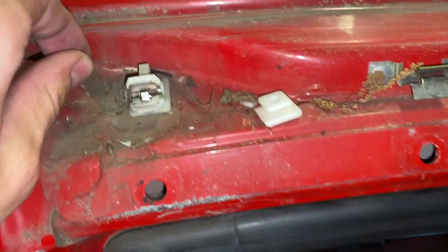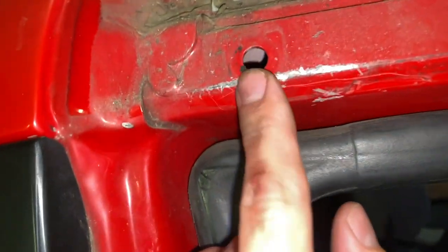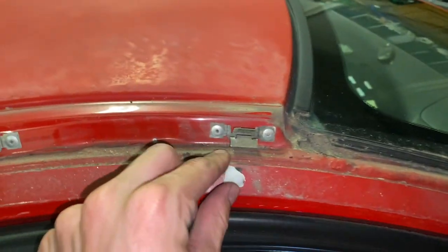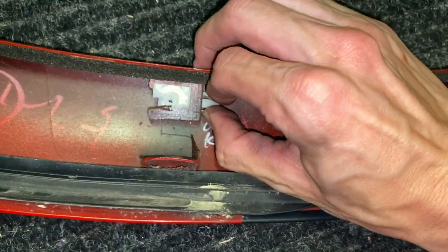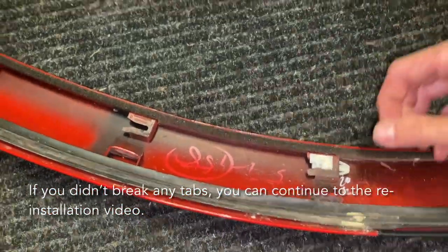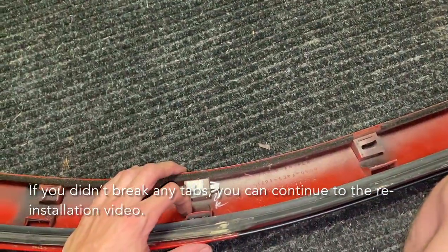What you're gonna do next is clean all this up — these are the remnants of those clips that we had to cut. With my imperfect tools I did not break any of the clips off of this panel, but right here I did kind of snap this one. On the other side it had to completely come off. This is the positioning clip — just use a plier to pinch that together, pull that out, and you'll put one of the new clips in there. Remove the plastic out of the rest of these clips and then get ready to reinstall.